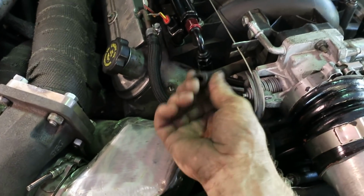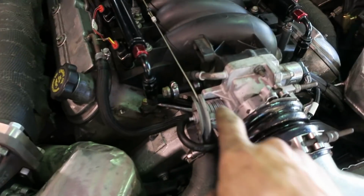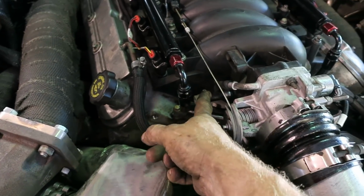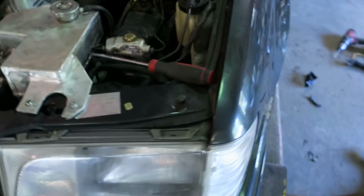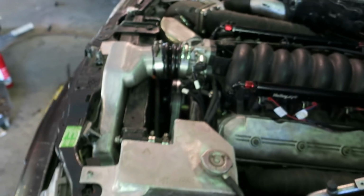It's funny. I had this disconnected, massive vacuum leak. Let's fix that and see how it runs. All right, got that one going to the map. I got this one plugged. And I got this one going to my blow-off valve. That should be better. Let's try that before we get ahead of ourselves. That's what happens, get a little too excited. See if it runs any better.